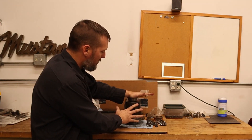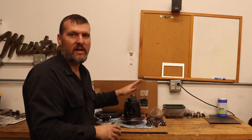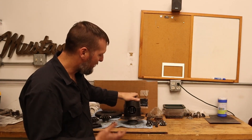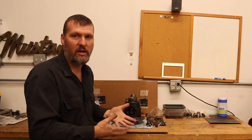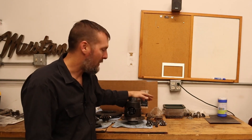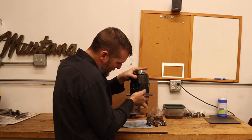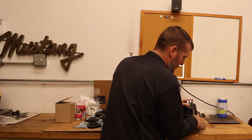This is an Auburn Gear autocross-specific cone clutch style differential. This one is actually discontinued — they don't make it anymore, maybe for a certain reason. So I can't really get it and I can't get it serviced. You can't take any of it apart yourself; you actually have to send it to Auburn. They used to have an exchange program, but they don't have that program anymore. Looking in there, I can kind of see the cone a little bit and there are some wear marks on it, so that's not too good.